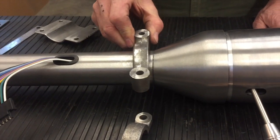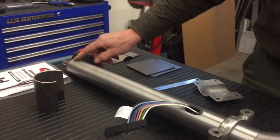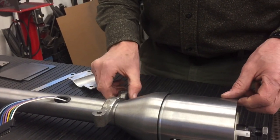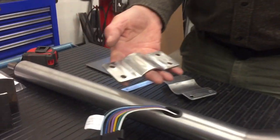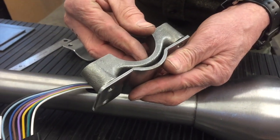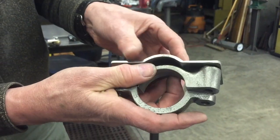So I needed to move the bracket down, mount it farther down on the column, so that I could do a couple of things: get this to go through the floor, and scooch the column closer to the dash, which would give me even more arm room. In order to move this, I had to come up with a bracket. The first bracket I came up with is about an inch and an eighth. The column lays into it, then this goes on top and holds the column, and it fits in the dash with this curved piece fitting into the curved piece on the dash.